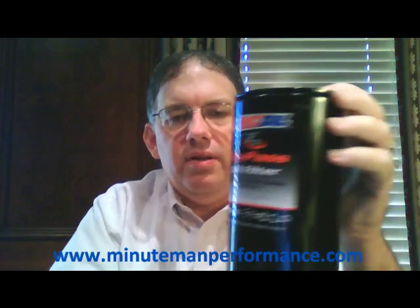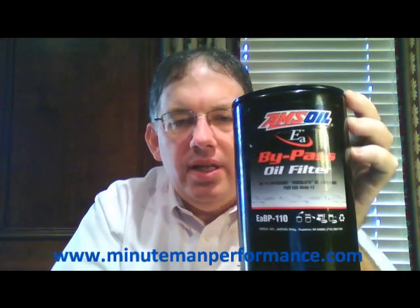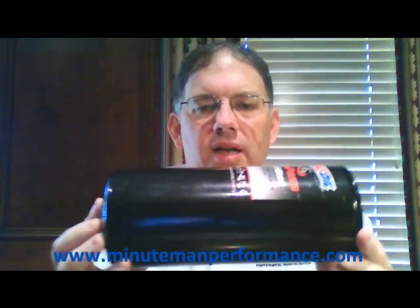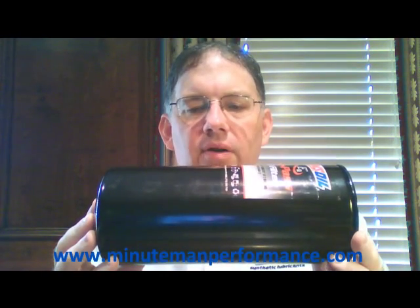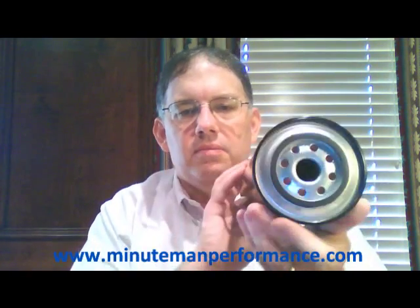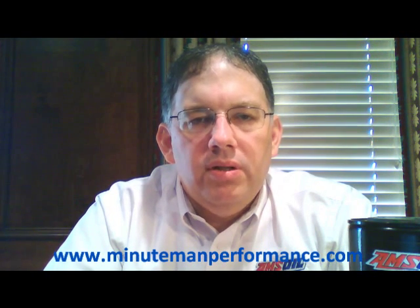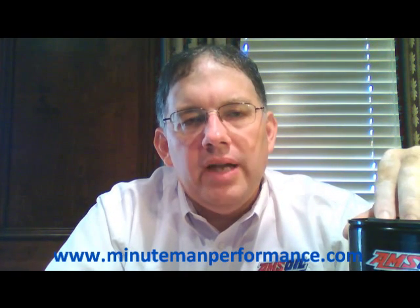Here is a picture of the EABP 110 filter element — there's a shot of it lengthwise. This is about a foot long, and there's a shot at the end. Although this looks like just a large conventional oil filter, this is a bypass filter. The difference is that whereas a conventional full-flow filter is going to filter down to 20 microns, in the case of an AMSOIL EA filter, these bypass filters are going to filter down to between one and two microns.